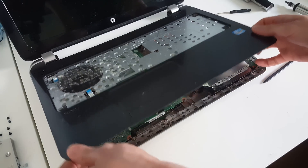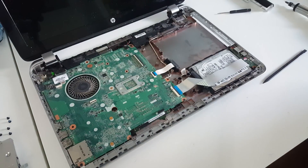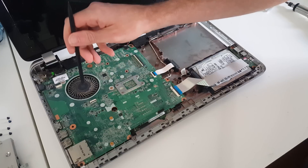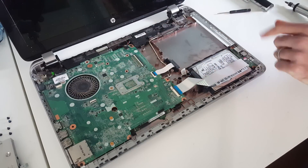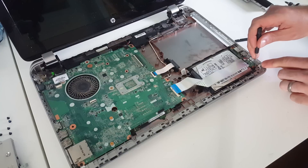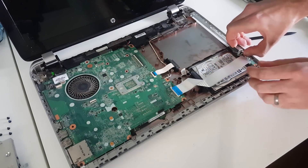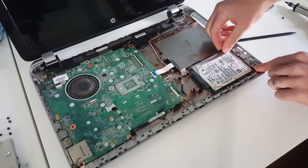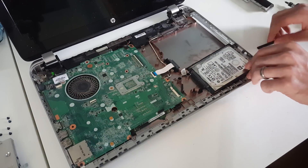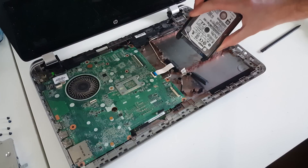Having got round there, we should just be able to lift the panel out. This gives us access to the internals of the laptop. If we wanted to do anything with the cooler it would be main board out, in which case we'd need to remove the RAM and other bits. Since I'm only interested in the hard drive today, I need to release this daughter board clip — the easiest way is to take this single screw out from the daughter board for the USB, sound, and LEDs, and lift that out, because it's also clamping down the hard drive. Trying to keep that in place and lift it can cause problems as you'd start to bend the board. Then get in under the hard drive, tilt the screen to stop it falling backwards, unplug it, and that is our drive removed. Now we're going to fit a replacement drive in here and get this system back up and running.